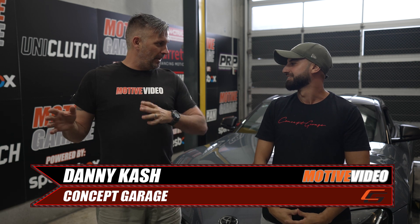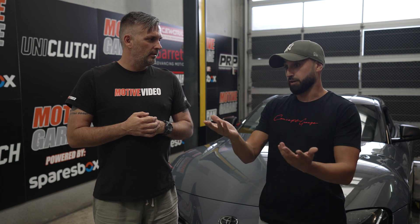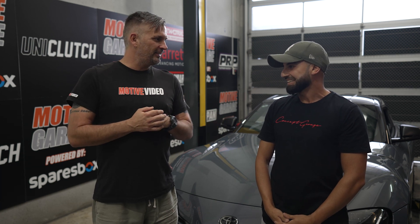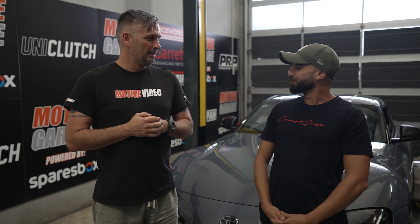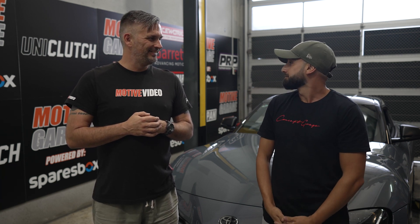I know you just love fitting other people's body kit parts — being sarcastic, obviously. But just run us through — people don't realise even the best brands, even the worst brands, don't always fit to perfection, right? We're going from OEM parts and OEM built cars into aftermarket composite stuff, and depending on where it's built — locally or overseas — too many conditions come through, so fitment is never going to be the same. You think you can do it at home, start drilling holes and pulling it tight, but if you want to get it perfect, it's a bit more work, a bit more skill, a bit more swearing, and some long days. They're not always going to fit to plan — you may need to modify a hole, extend a hole, put some tape, cut, trim, or remake.